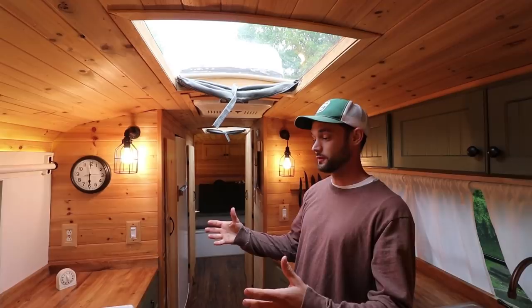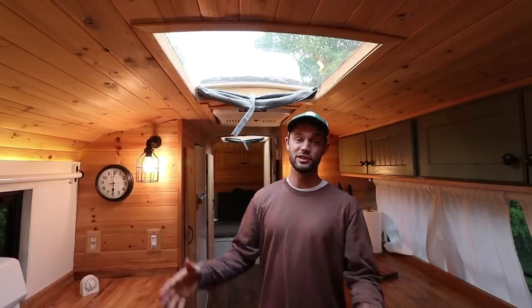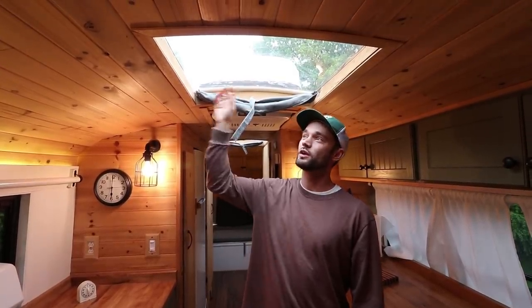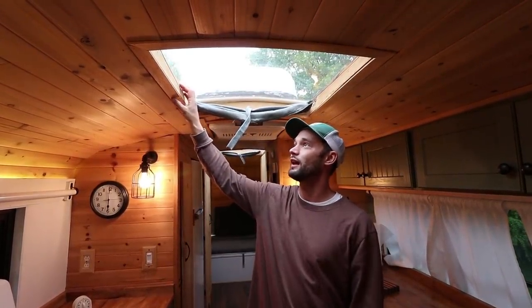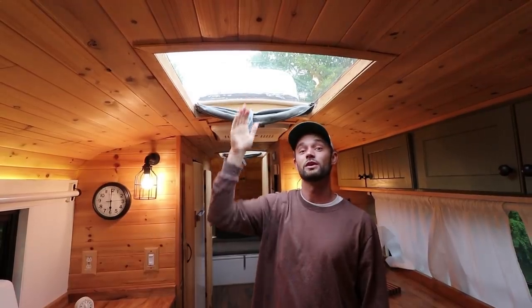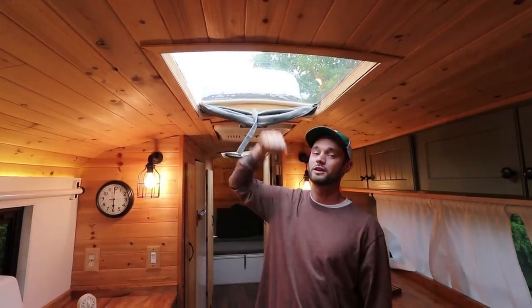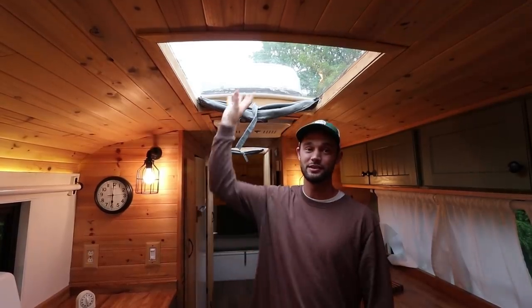In my kitchen, it was super important to have open space for cooking, but I also did natural light — I put a skylight directly in the middle of the kitchen. I love it and I would do it again. My only suggestion is that I used a high-grade plexiglass. It works great and was easy to bend over the curve of the bus, but it's really hard to mold on the inside. Over time, unless you use a really good plexiglass, it is possible for them to crack where you attach it — I've had one crack before. What I would do now is just buy marine hatches that open, which gives you a lot more ventilation. If you're looking for a skylight that opens, go towards the marine hatches.